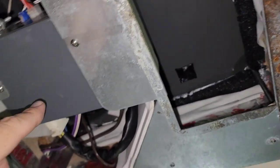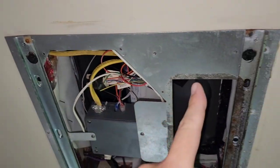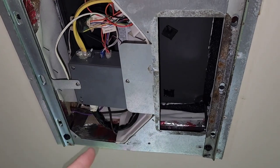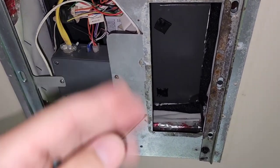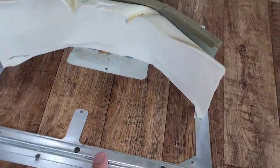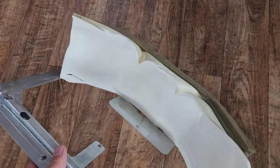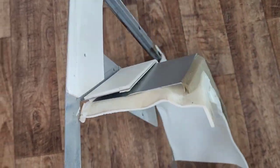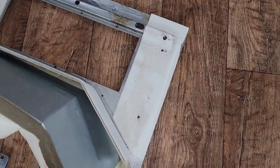And I'm going to get rid of this divider right here to do that. So to get rid of the divider, I'm going to have to unscrew this control box, take these bolts out, and drop this entire mounting pan assembly down out of the way so I can work here. Alright, I just got this down. You can see I got that nice metal-ish foam divider there that does not a lot. So I'm going to take that out — probably at least part of it.